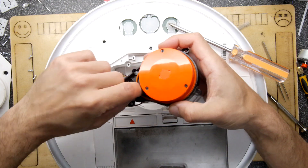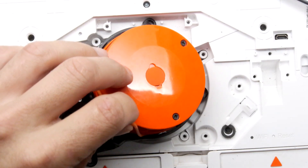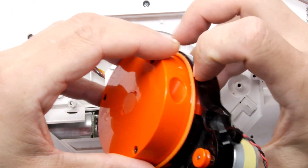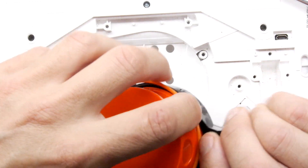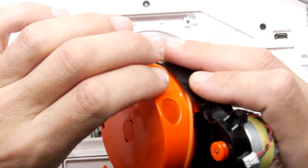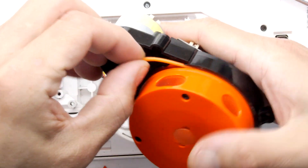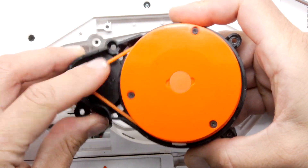Now I'm going to show you how to move the belt on and off, because there is a possibility your belt will be gone or damaged. If your belt is gone, you're going to want to know how to spread on your new belt. Whip that belt off like that — now you've got no belt. Pretend this is your new belt. What you do is hold it between the black plastic and the orange plastic of the radar, the laser lidar assembly. Push it through, hold this end against it so you can pull it, and as you twist, you can see it getting pulled into that channel — all the way around. Just hook it over to the motor, and that looks like it's going to do well.